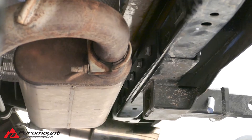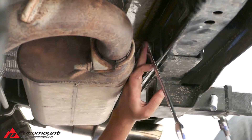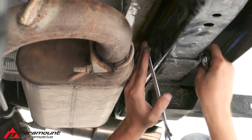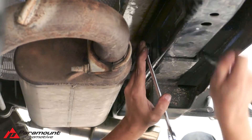Slide back under the center of the rear of the vehicle. Place the provided long bracket up to the four holes in the frame near the exhaust system. Using the provided M12 long bolts, push them through the bracket and bumper, then thread on the lock nuts. Align the bumper to the desired position and tighten down all bolts and nuts.